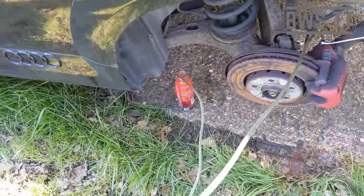The advantage of using a big long hose like this is you can see the difference between old and new fluid at different ends of the line. It's a gradual change, but you will see the difference between the nice clear slightly yellow fluid and the old dark green browny murky stuff. So this side looks fine.